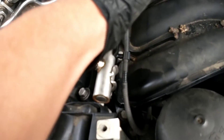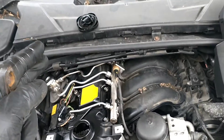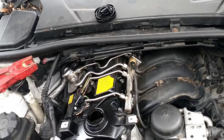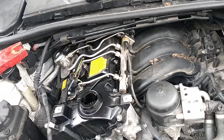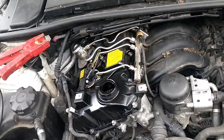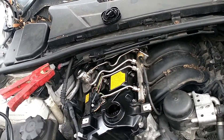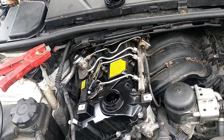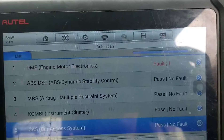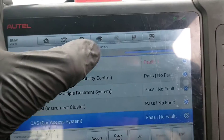We've opened the fuel rail and we can see we are getting fuel. If we turn the ignition on, fuel is coming out and we can hear the engine jump and stutter a little bit as it's trying to start. It's cranking, which is a bit confusing. The starter motor fault that was there has now cleared and disappeared, so all we're left with is one fault.